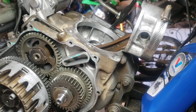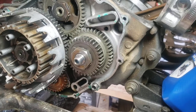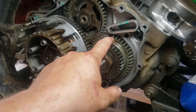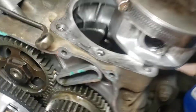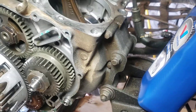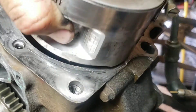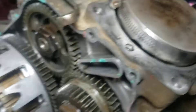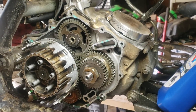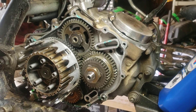I'm hoping we don't run into any more issues. So far everything looks good — all the bearings are good. It's just that one tooth that's got a chunk out of it. I've looked down into the bottom of the motor and I don't see a bunch of metal in there — it looks good. The crankshaft does have some blueing on it right there, so I'd guarantee they got it hot. That's probably why they rebuilt the top end the first time — either that or somebody just wanted a 686 big bore kit.